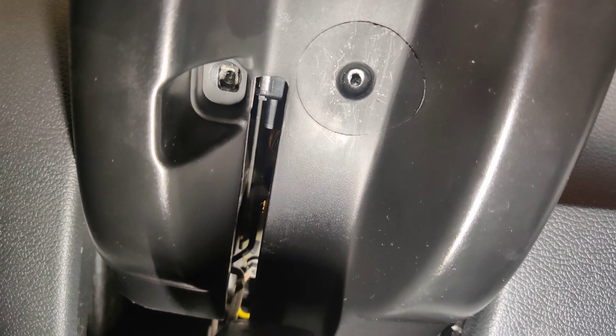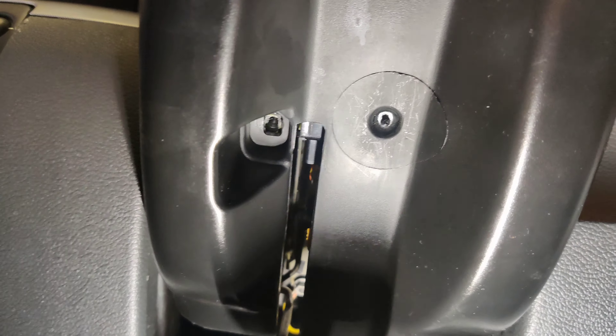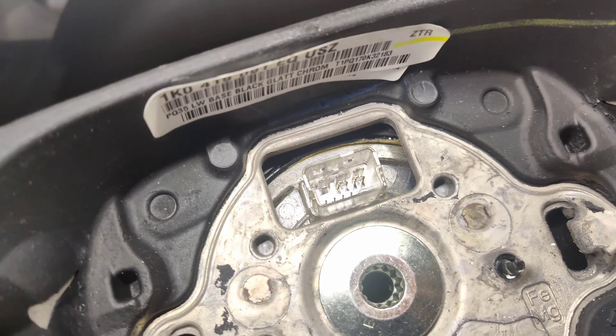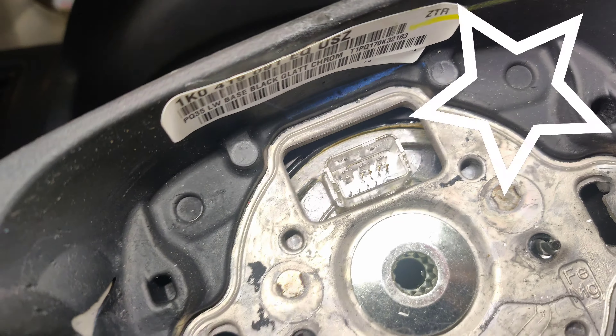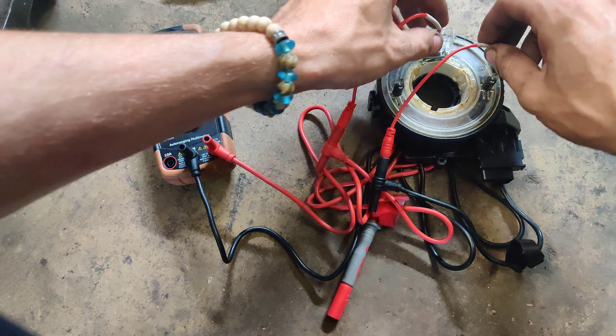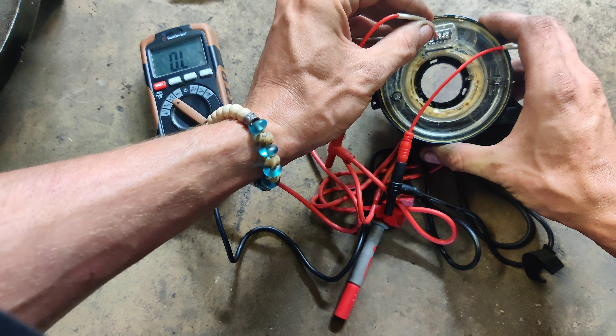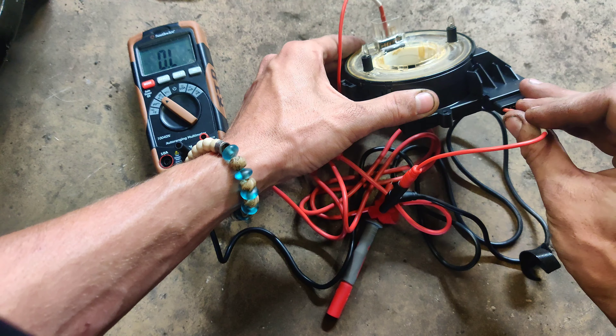So let's see if we can clear this. So it's back. Let's read our data stream - we might not be making a good connection with our resistor. Airbag driver's side. We want driver's side. Actually I think that was the only one that we needed. Too high. So I'm going to quick check my resistor because maybe it's not making good contact.